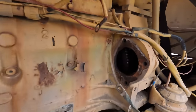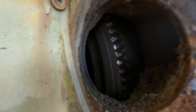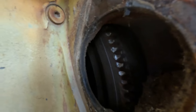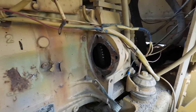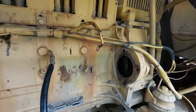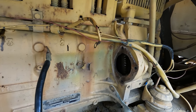The bad news is on the flywheel where the starter engages, you can see those teeth have been incurring some damage from the crappy Bendix. That's a bummer, but it doesn't look like a showstopper — it seems like it's just in this one spot where the engine probably likes to stop. These teeth down here don't seem so bad. Another thing we can do to help starter performance before installing the new one: we're going to clean up all these connections really good, make sure we have a clean bare metal surface. Hopefully this thing cranks over worlds faster, because I think that's the reason it's a little hard starting — it just turns over too slow.